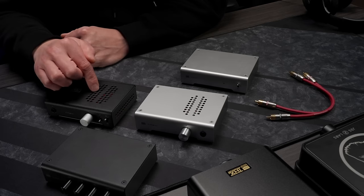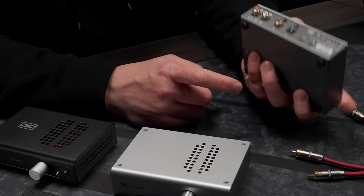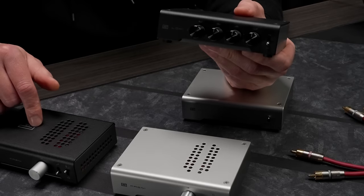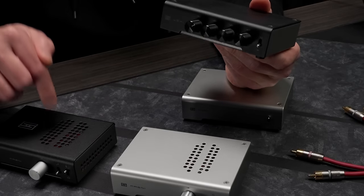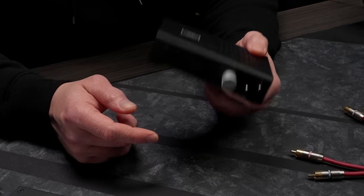My copy of the Modi is older, but I really can't tell any meaningful difference between the internal DAC card on the Unity and the full external Modi DAC. It really just comes down to IO. On the Unity, all you're going to have is RCA and USB-C in. If you go with the full external Modi, you also get coax and optical in as well. The other big advantage of going with the full stack is that you can implement other Schiit modules like their Loki EQ module — this does not work with the Unity because there's no way to round-trip the signal back into the unit.